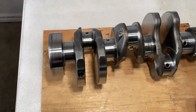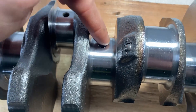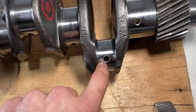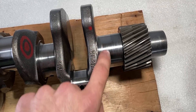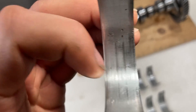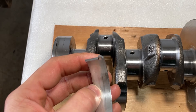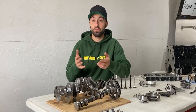Another thing I found on this crankshaft that I don't like — these oil ports or oil passages — the chamfer around the oil passage itself is a little bit higher than the surface of the journal. It's not on all of them, but the chamfer is just a little bit too high and I don't like the finish on them. I'm going to have to polish the outside perimeter of this chamfer so I do not have any high spots bigger than the diameter of the bearing journal. You can see on these main bearings there's a line towards the middle, and that's worn a little bit more than the overall surface — those lines must be from those chamfers. It's just up to me to touch that up and make it better.